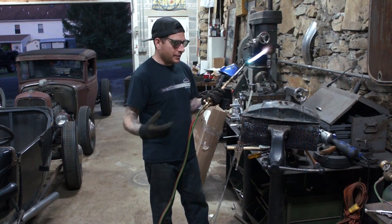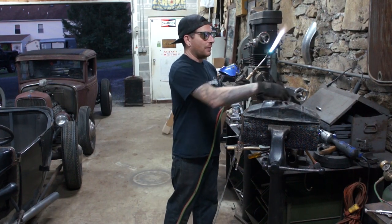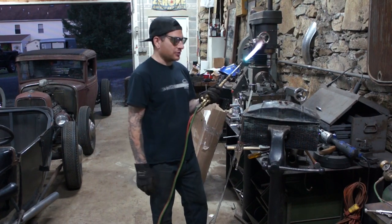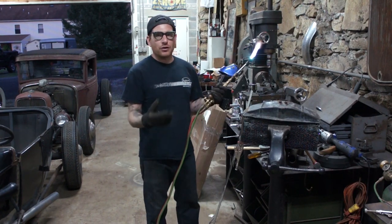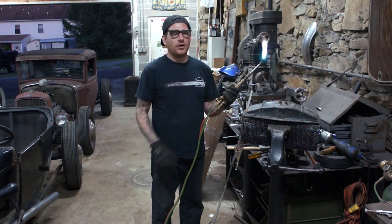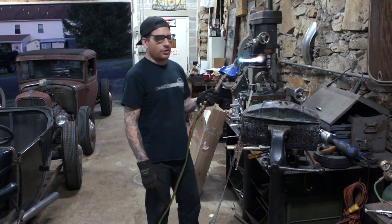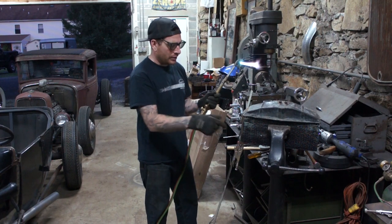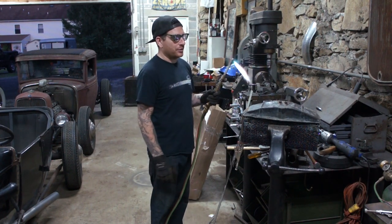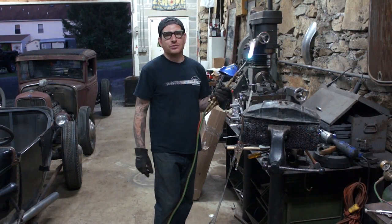So they're not welded, sometimes they're riveted, but especially these side brackets and these top brackets that hold the grill and stuff, and the rods, they're usually just soldered on. So what you need to do, if you have a propane torch, you can do this and it's a little slower. If you turn a softer flame on and keep it kind of lower with an oxyacetylene torch and you hold it back a little further, you can melt the solder out, and with a pair of pliers just kind of pull it off. Just got to be careful that you are mindful you're not putting too much heat into it, because a lot of these have copper tanks and you can easily blow a hole in them.